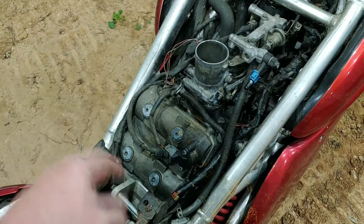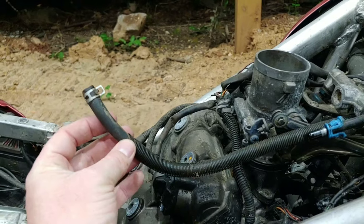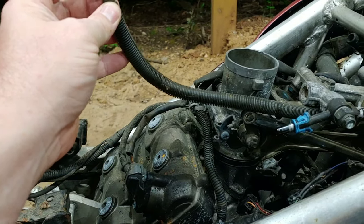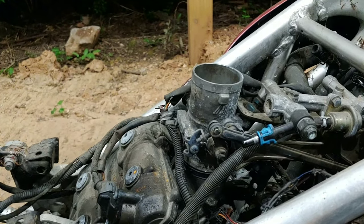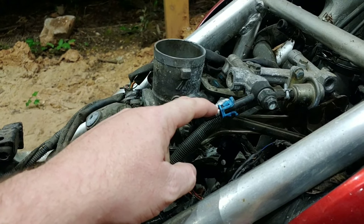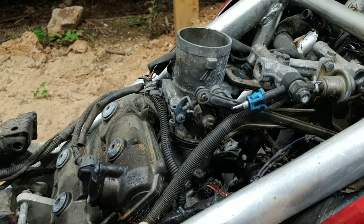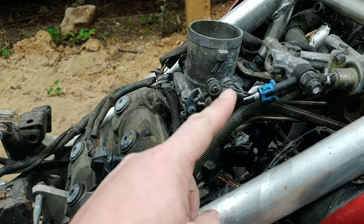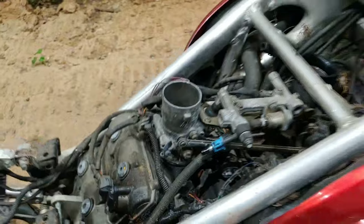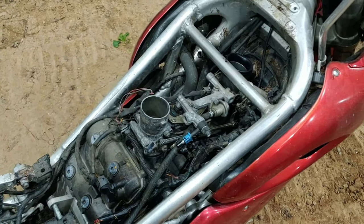Most of the fire was in this area on the back. This fuel return line was burnt, so this is a brand new one - I replaced it a while back. The fuel line that connects to this connector right here, going to the tank - this is the pressure line - that is what was leaking. It dripped straight down and burnt on the previous owner, so that's why this bike caught fire from a leaky gas hose.